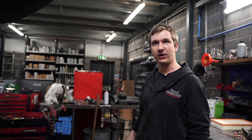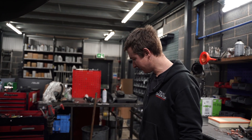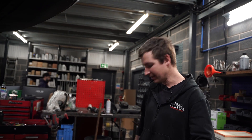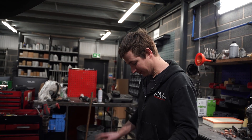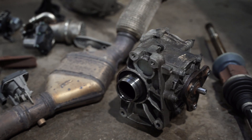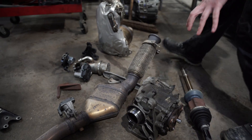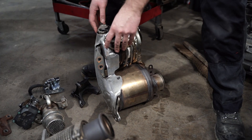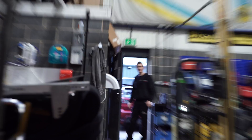Paul has had a good couple of hours hacking away at this, maybe a little bit longer. He's finally got everything ripped out. It's a lot of stuff to get at. The first thing to come out is the full subframe, which is standard when you're doing all modern stuff. Then the driveshaft which goes all the way through to the other side into the diff, which is a bit odd. The transfer case has to come out as well, which obviously to get the DPF out on four-wheel drive stuff, that happens.